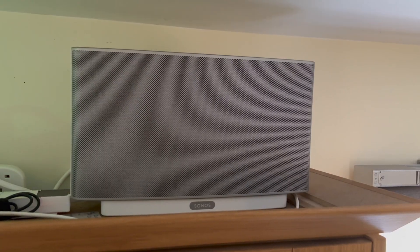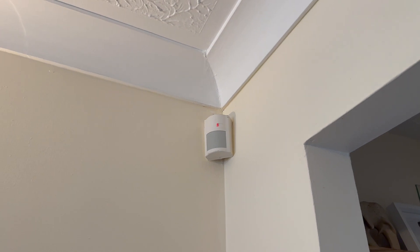I've also created some standby killer automations, because things like my really old Sharp TV and my Sonos speakers use quite a few watts of power when left in standby. While it's very convenient to have them ready to go, there's no need to have them on if there's nobody around to use them. I created a couple of very simple automations that monitor a room for motion. When it detects motion, it toggles a smart plug on. Connected to that smart plug is my TV kit in the living room, or in the kitchen I have a Sonos speaker and Echo Dot.